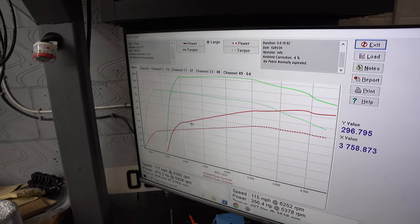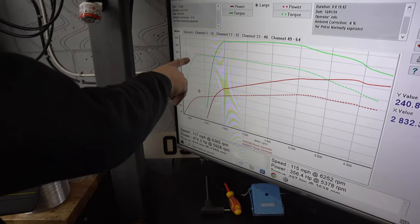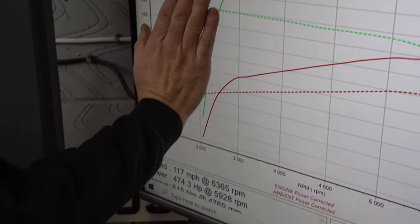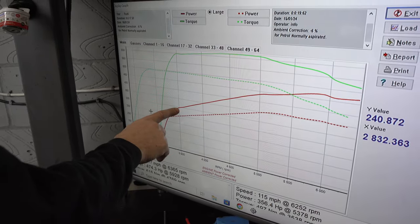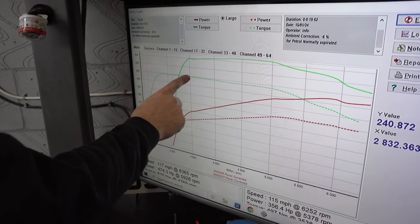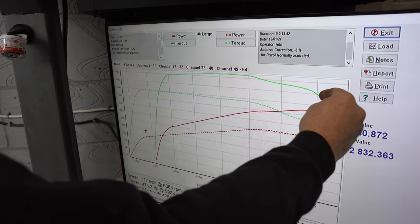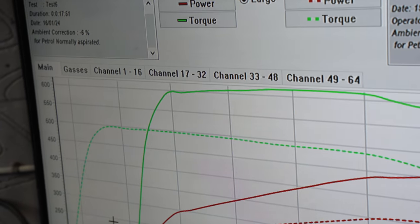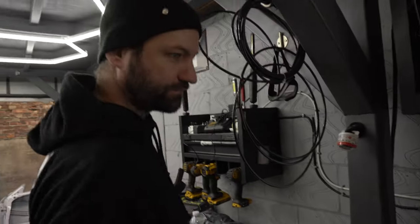See, so this here is the dyno issue. On a stock turbo, the torque comes in so quick that the dyno quickly grabs it. Over here, it's only 500 RPM, so we should negate pretty much all of that. So we can look from here, 3,500 at 100% throttle. There's our difference, 50 horsepower in the beginning and about 100 newton meters. And at the end of the RPM range, about 470 there, and over here you're at 350. So it runs out of puff pretty quickly.